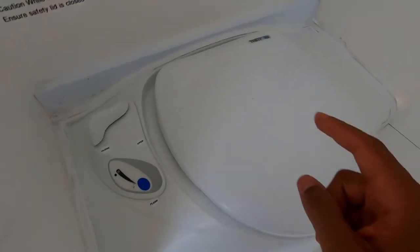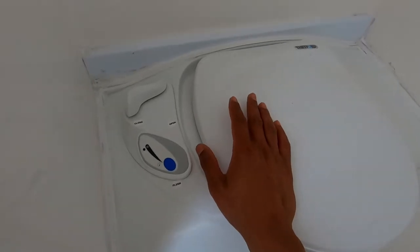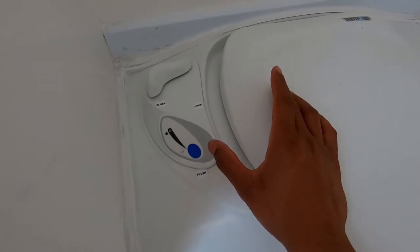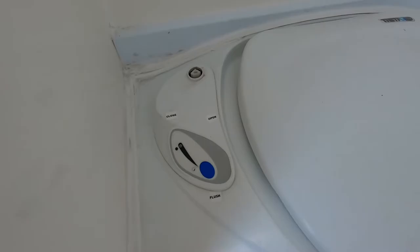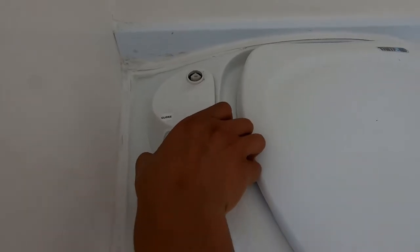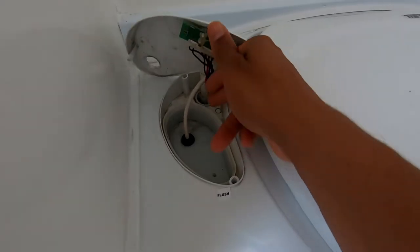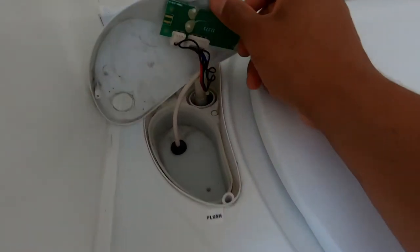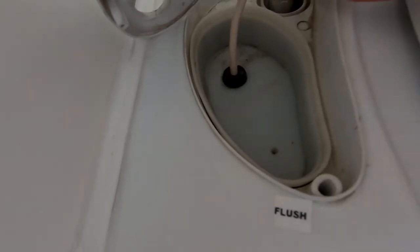Most of the time with these toilets, what happens is the actual pump plays up. When you leave water and leave the camper sitting for some time, the water gets mold on it and basically clogs up the pump. Or if people put the wrong type of flush liquid into the toilet flush system, that also damages the pump. To access the pump, open this area here — start by pulling this out, it's the handle for the toilet, then gently pry this up. You'll access the control board for your level indicator and your flush — your pump is situated just underneath.